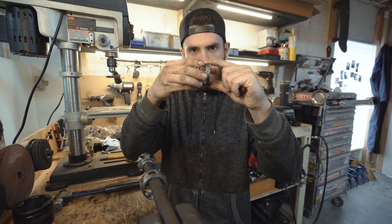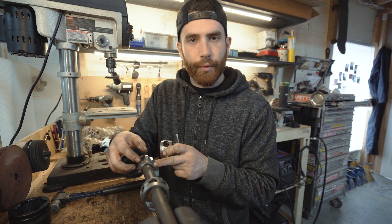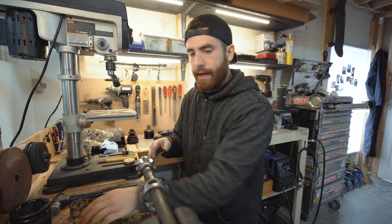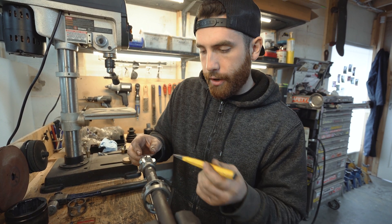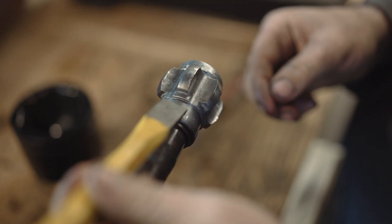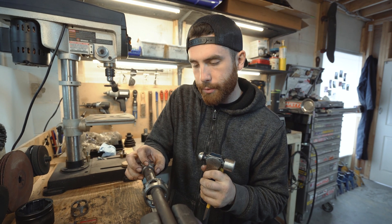The cage has to go with the small edge facing the inboard side. In order to get this off, we need to take off the inner race of the CV joint. To do that, you're going to need the axle in a vise, nice and tight. Using a punch — not on the surface where the ball bearings ride, but on this edge right here — you want to hit it with a hammer and this entire section will just pop off.